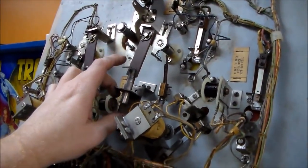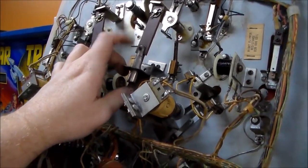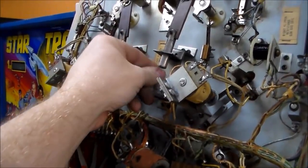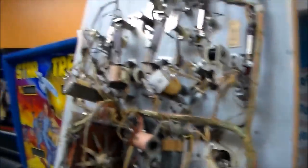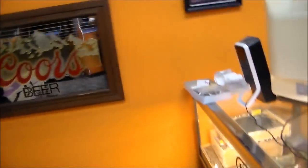So if you're a home hobbyist, it's probably better to just buy the linkage already attached to the plunger. If the plunger has any sharp edges on the bottom, that will cut up your nylon sleeve and slow the coil down too, which is what's ultimately making the flipper weak.